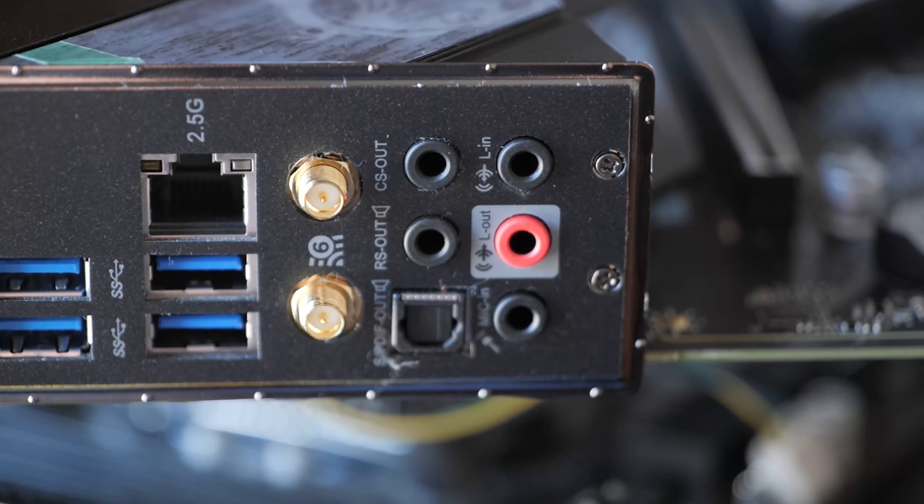That's pretty much the maximum top-end build with this motherboard unless you go for an i9, in which case cooling matters a lot more. The box for this cooler says 150W TDP, but Intel's playing games with that rating — you're going to need about 200W of cooling capacity with an overclock on these more extreme processors. Intel has made improvements to the integrated heat spreader for heat management on 10th gen. For $40 and an i5 at 5 GHz all six cores, this setup is great — basically matching the Intel 8086 Anniversary Edition performance.